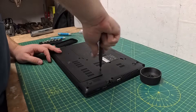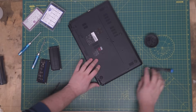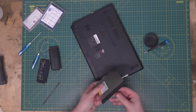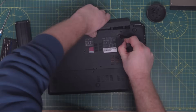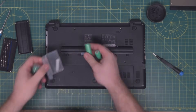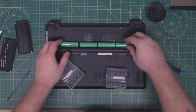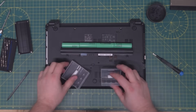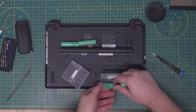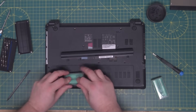To get access inside, we need to undo an ungodly amount of screws on the back panel. Back in 2013, laptops still had these things called CD drives, so I pop that out, then pull out the battery. This battery is listed as 14.8V, but personally I'd say it's a 16V battery, as I suspect it has four 18650 cells in this casing. With a fully charged voltage per cell of 4.2V, 14.8V would be its nominal voltage of 3.7V per cell — some rather exciting battery trivia there.